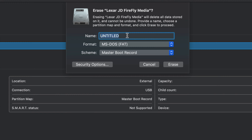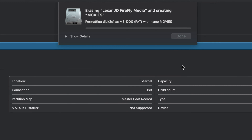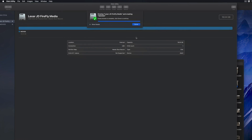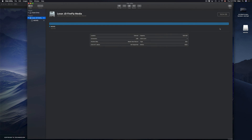You can name your USB stick or external hard drive right here in the name field. You can call it Test, Hard Drive, Backup, Movies — anything you want. Then click Erase and there we go. Those are the options you have to try out with your TV. Since I don't know exactly what TV you guys have, I'm not 100% sure which option will work, but try the first one — exFAT — and if it doesn't work, try FAT. One of these will most likely work for most of you.